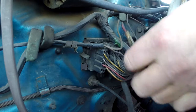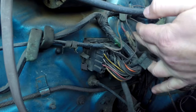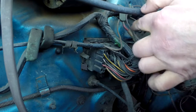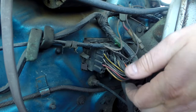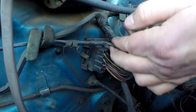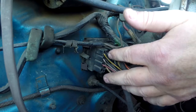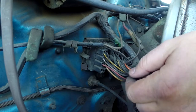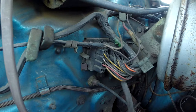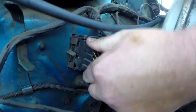This one's marked fusible link, so I'll definitely be checking that. It's a kind of a weird one — this one actually has a fuse right inside this plastic container, whereas usually that's an embedded piece of wire designed to burn at a certain temperature. This is the bane of Chrysler owners everywhere. It works okay when it's working, but these connections get corroded and then you're stuck. So we'll be taking those off and having a look.